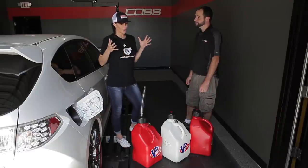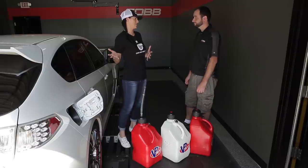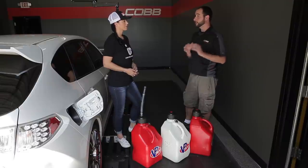Okay, so we're doing this for the dyno, but how does this translate when I'm just going to the gas station to put some E85 in it? Sure, yeah, and that's going to be your normal day-to-day scenario. In that case, it doesn't matter how much fuel is in the car at the time. You can fill it up, you can fill it halfway, whatever you've got to do, and the flex fuel system is going to calculate how much ethanol percentage is in the fuel right now, and it's going to adapt accordingly.